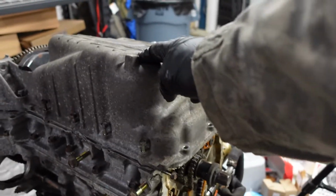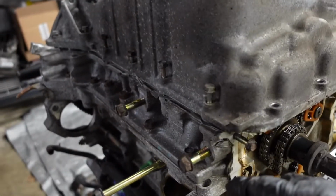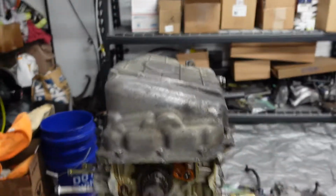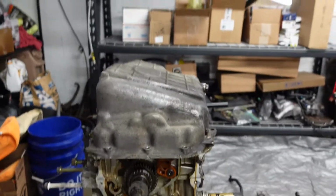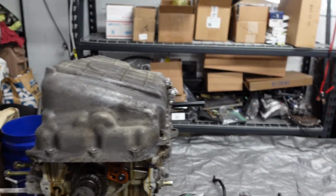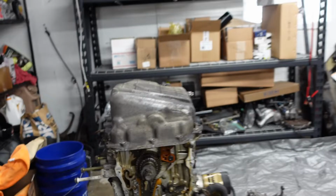So, working on the oil pan, one thing to be careful of is not to scuff up the mating surface when you're trying to actually get the oil pan off. There's two places Honda made for you to be able to pry. One's right here, there's a little divot where you can pry up. The other is on the other side. There's a divot right here where you can pry up. Those should be the only two places you're really prying at. That way you don't scuff up the aluminum, because just remember, aluminum is definitely a soft metal and you can gouge it, and that can lead to leaks further down the line. Next thing you know, you're trying to take off the oil pan to re-Honda bond it, still leaking, whatever. And yeah, we don't want the engines to leak, right?